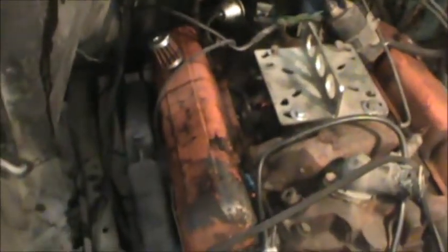All right, our mission with the G20, or GMC G20, it's in, as you can see. We've got the radiator, fan shroud, all that stuff out of the way, engine accessories out of the way, pulled the carb, put a pull plate on there so we don't have to worry about stuff getting in there. This engine actually is the entire thrust of what we're dealing with right now. Eventually we're going to work with the owner and give him a new truck out of this.